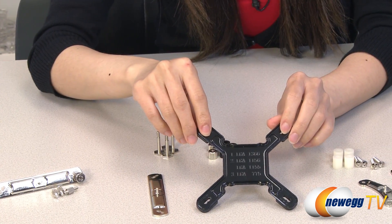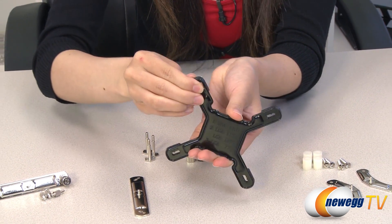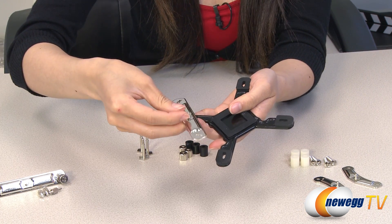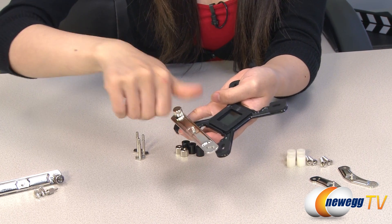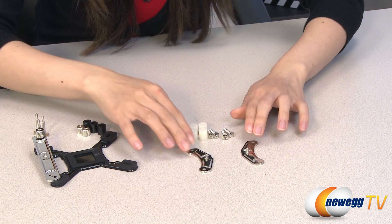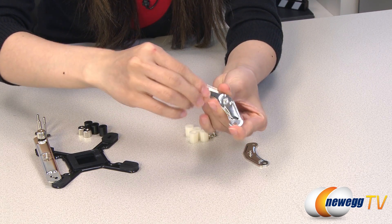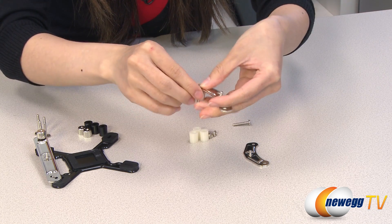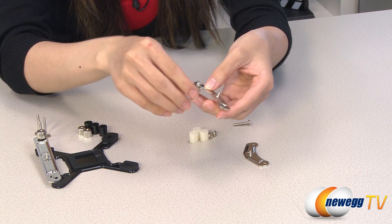For all other Intel sockets, you'll need this back plate. First, you'll want to push this screw through the correct hole depending on which socket you're using, then put the stud on top. The retention plate comes next, and finally the nut — screw it into place nice and tight and you're good to go. Finally, for the AMD set, this is the simplest of all. Mount it with the retention plates facing this way, place a screw through this one hole here with the stud just below it, and screw it in nice and tight. You'll have to use the AMD stock back plate that comes with your AMD motherboard.